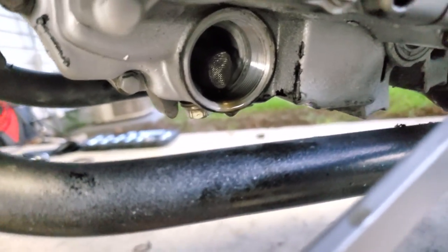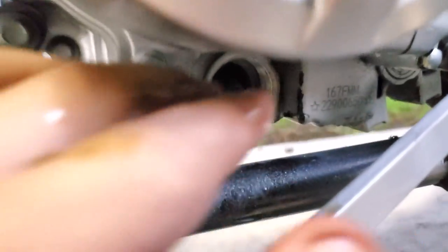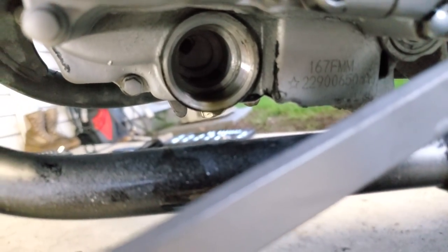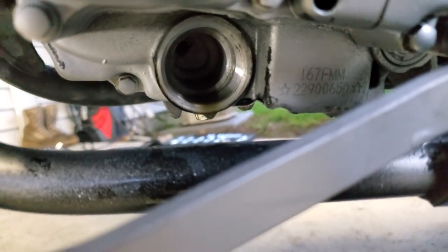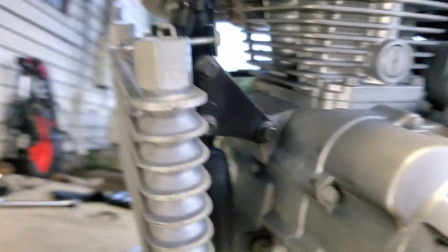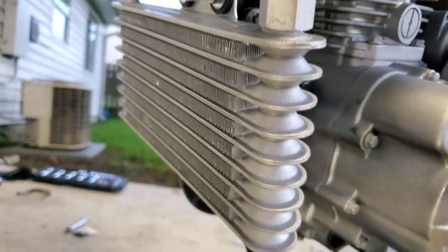I've got that out with a little bit of oil dripping — tiny bit of leftover, that's fine. I've got to get this oil screen out. How this works: your oil pump gear is going to be pushing oil through this, then it's going to go through your lines and circulate via oil pressure — that's how it circulates through your system.